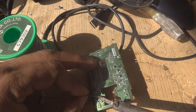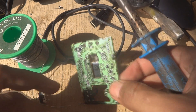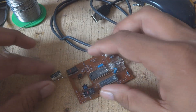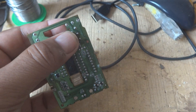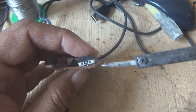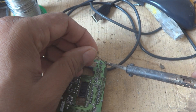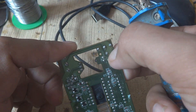Now I'm going to melt new solder so it will be soldered properly. Even if you reverse the position it may not be a problem because these legs are in parallel. We do the same on the second position. Now we solder the second switch — the good one removed from under the wheel — into the left click position, adding fresh solder on all three legs.